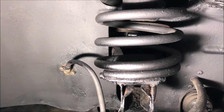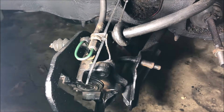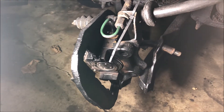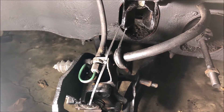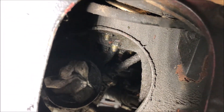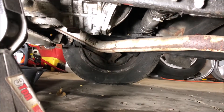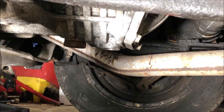This is where the difficult-to-get-to part begins. I have pretty much everything out from this wheel well — the tie rod end, both ball joints. I'm replacing the CV axle, the rotor, and the hub is getting a new bearing, so this is all out of the way already. This is kind of what you'd have to do if you weren't already doing it. Looking up inside the drive tunnel, you can see right there — there are two 13 millimeter nuts. I loosened those up and then put a jack at the back of the transmission, right below the drain plug. With all the bolts loosened up, I gently lifted up the engine, and the studs lifted up through with the bolts removed.